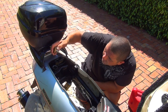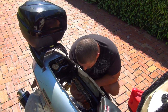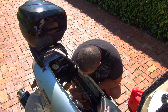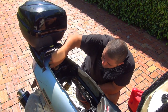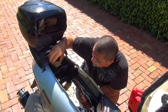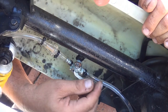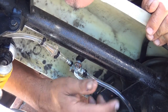Make sure you close the fuel tank so nothing splashes in your eyes. Then open the fuel switch you just placed and turn it on. If you don't see any fuel coming out, open the cap because sometimes it creates a vacuum and doesn't let fuel through the system. After placing fuel in the tank, turn the switch on and you can see the fuel going to the other side and to the carburetor.